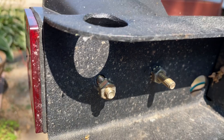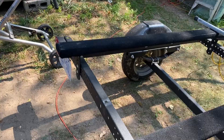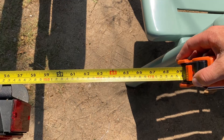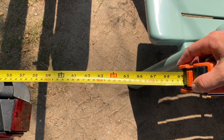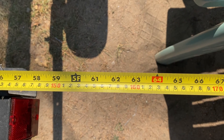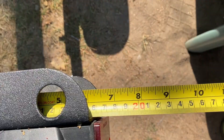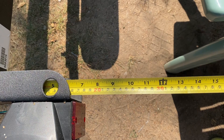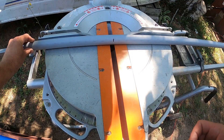To mount it I'm going to take off these nuts and then drill holes in the side of the PVC, then have my vertical post attached there. The widest point of my boat is 64 inches, so I'm just going to start off by measuring where 64 inches will take me — I'll need to give myself another inch or two on each side for clearance, so we'll say 66 inches. At about 56 and a half we want it to stick out another 10 inches, so I'll cut my PVC to 11 inches.